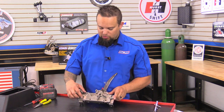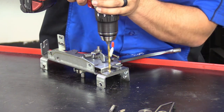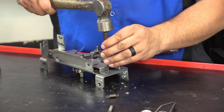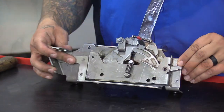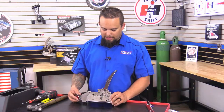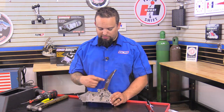The next thing you want to do is go ahead and drill out these four rivets right here. Now you have the rivets removed, go ahead and remove the brackets. Next you want to go ahead and remove this spring — you want to remove it at the pin that's attached to this chrome shifter stick.